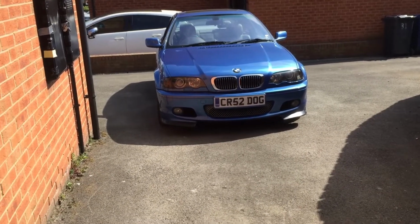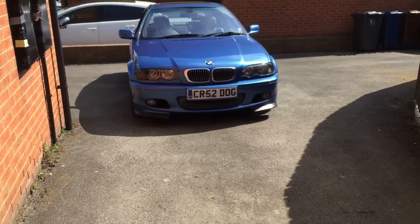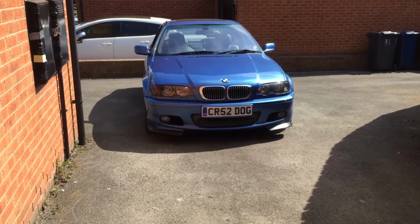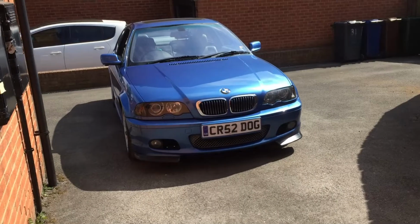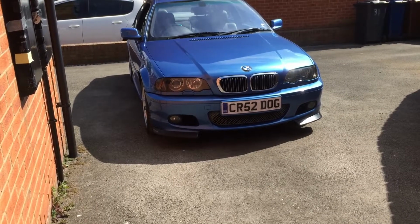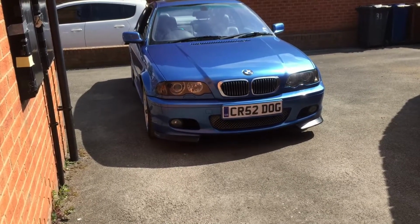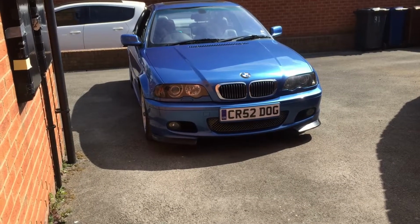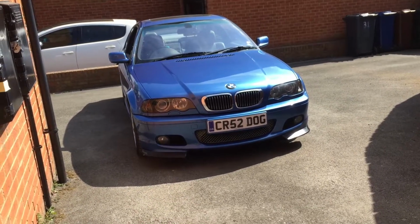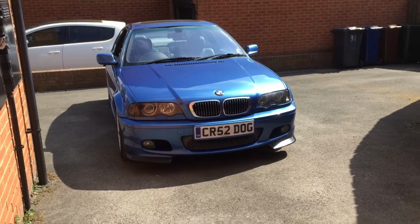Alright, so I just started the car for the third time to get it out of the garage, and I did hear the lifter tick, but it was less than half a second. It just went tick, tick, and went away. So I think it's trying to come back. But that was on the third start, which is weird. It leads me to think maybe it's going to come back in a few days, or maybe a week or 2 weeks. But I don't mind running that 2 minute, 3,000 revolution test again. Do it twice, just in case it needs a little bit more persuasion. I can't do it here with the neighbors. I don't want to sit on 3,000 revs with this thing, especially on a cold engine. I'd want it warmed up. But let's see what tomorrow brings.